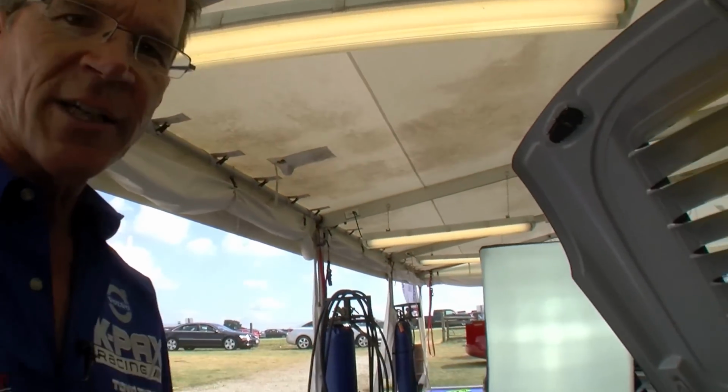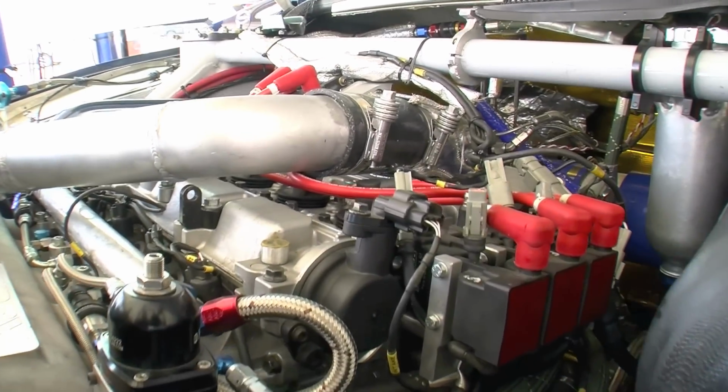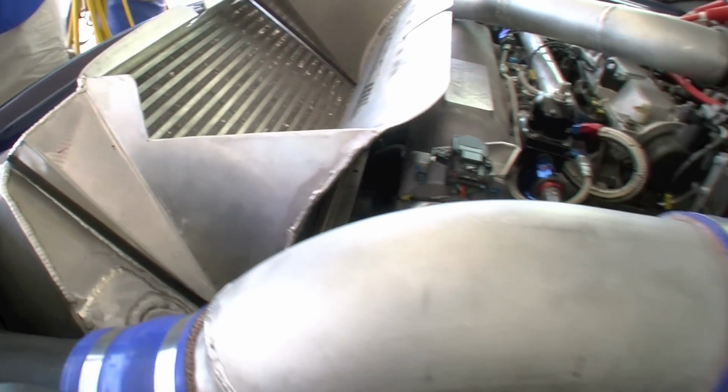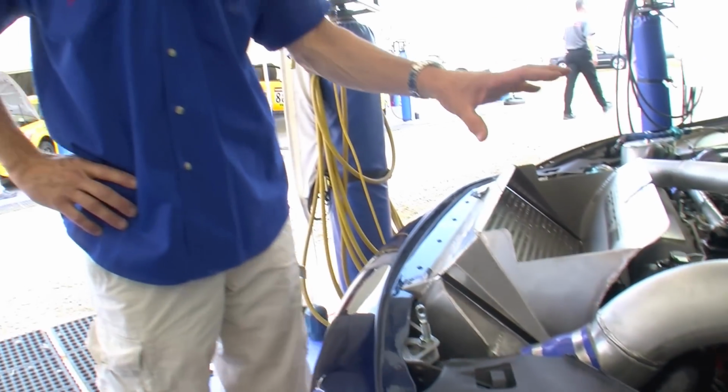It's a 5-cylinder, double overhead cam, 4 valves per cylinder, a modern engine, making more than double its capacity. It's incredible. We have an intercooler just like the street car, but it's twice as big. We have a turbo just like the street car. It's probably twice as big. And it's all attached to a custom-built 6-speed sequential racing transmission.